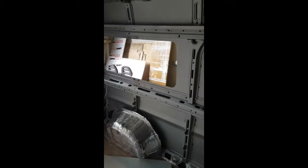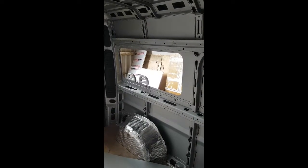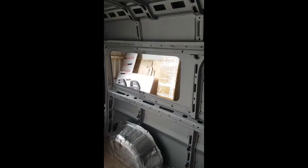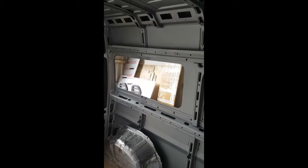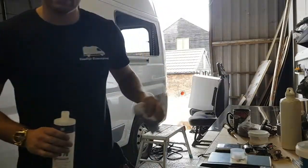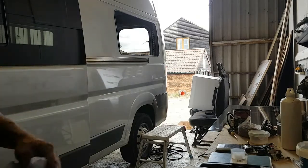Here's a view of the hole cut from the inside. Because I had that reference hole drilled first and was able to measure how big the aperture would be on the inside, I've missed all of the ribs above and below the aperture. So it's good to just check from the inside before making your cuts.